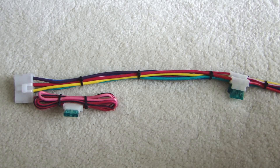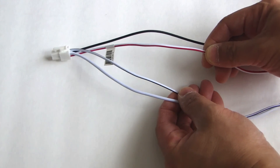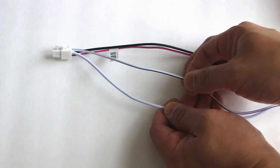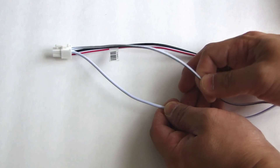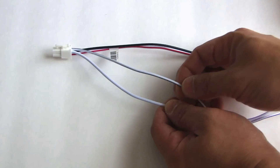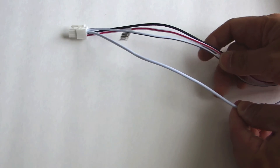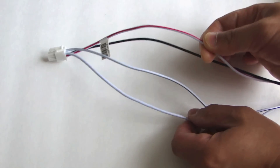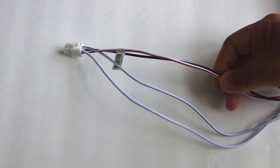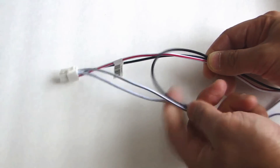This wiring harness is for the ground and the parking light input — it could be negative or positive. This black-white wire is the siren positive output, but you'll need also a common ground for the siren to work. So I'm going to run the ground from this common wire here as well. The white wire here is a parking light output, so depending on what you input on this red-white wire it will output onto this wire for the parking light. And I'm also adding my own ground that will run with the siren.